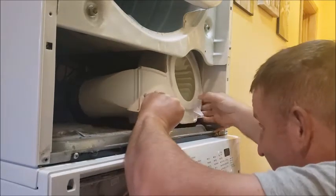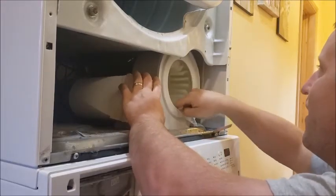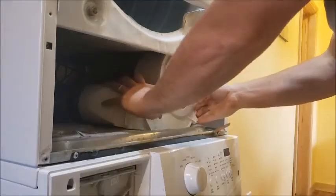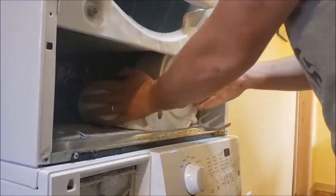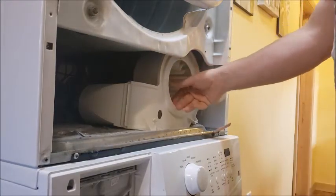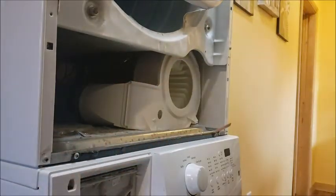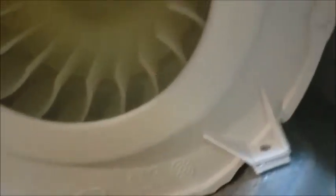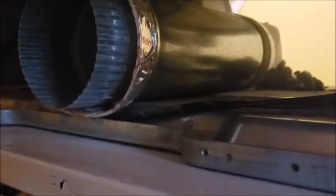I should be able to tip it enough. I still have my vice grips holding the motor in the back so I can tighten the fan on. It's reverse thread — go that way to tighten. That round part slid right into the exhaust. I kind of forgot to line that up, so that was fortunate. It looks like it's in the right spot.